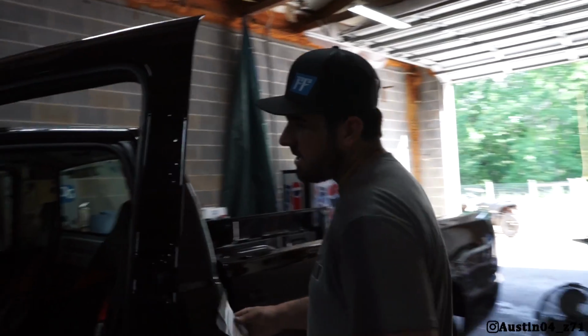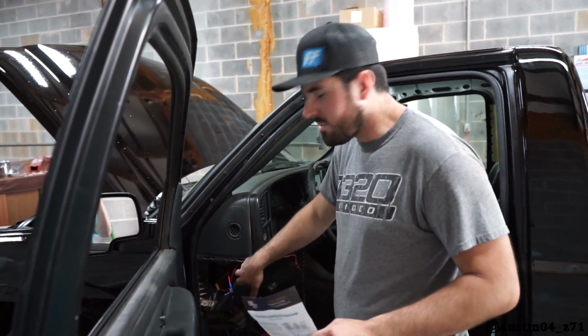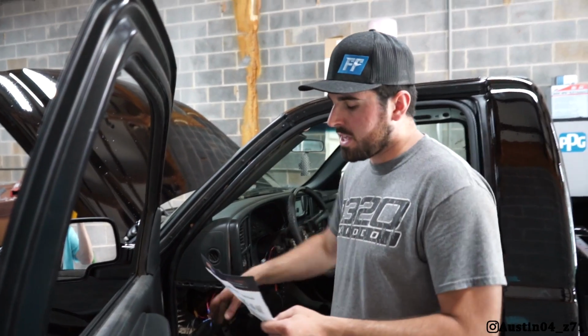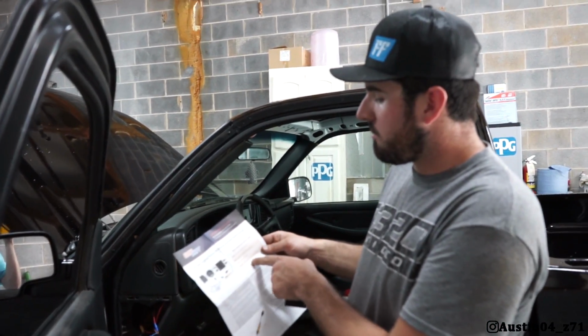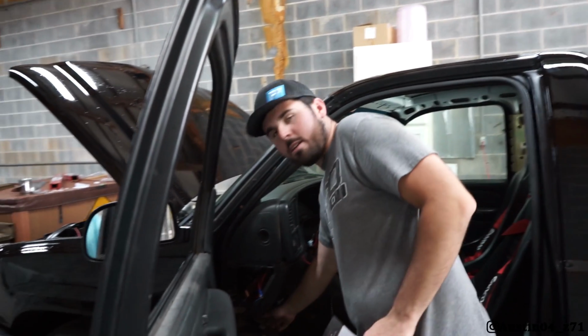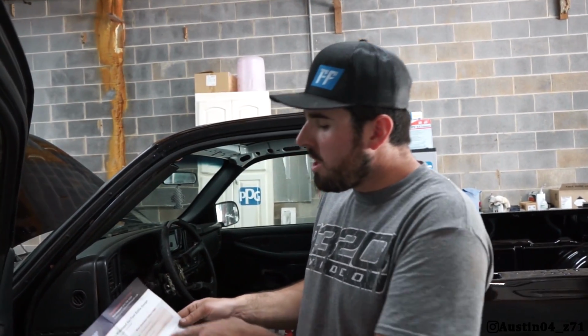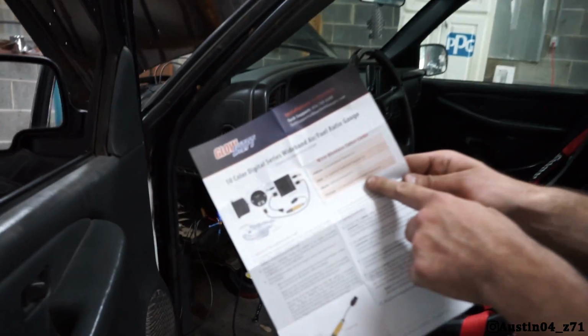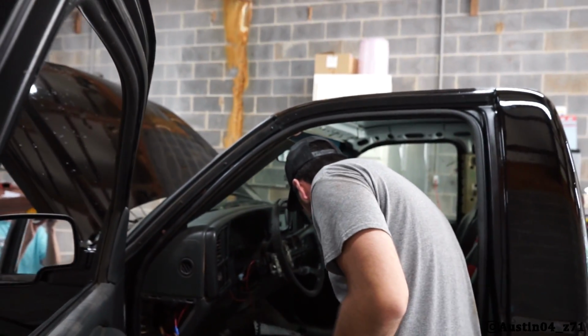Inside of this fuse box is literally an ignition switch, and it doesn't activate till the ignition turns on. I got a fuse tap, and put the fuse tap in there for red. Black is vehicle ground. Found a nut underneath below the steering column for ground. Put that on there. Orange is headlight switch. That's the dim for the headlight. I haven't wired that up yet. I've just wired power, ground, and stuff like that.